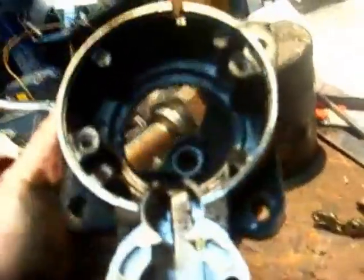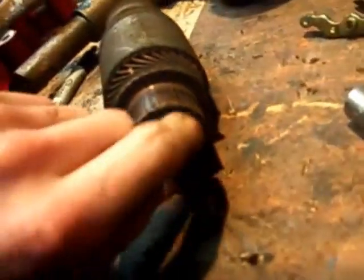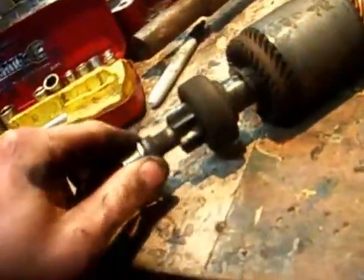So here's the rotor assembly, obviously. So now what I'll do is lift the plunger out and lift the fork. That pushes the cog out into the ring gear. So we want to keep all those little bushes and everything nice and clean. So there you go. Now there should be a bush in there, which there is. It's a bit rusty and yucky looking, so that's probably half our problem. Now try to keep track of your spacers and all that sort of junk.